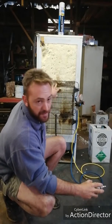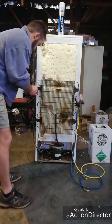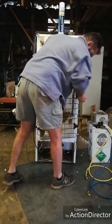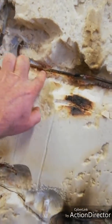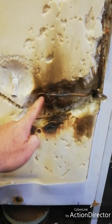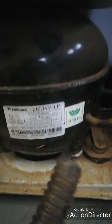I'm going to dismantle this quickly, take it off, and show you the old piping. Here's where I made a joint with copper pipe — this goes into the deep freeze section, coils on the inside, and comes back. And here's the new capillary tube that I laid in and wrapped around the suction line, which goes to the compressor. New capillary, new dryer, flushed the old system — this is a 134a system.